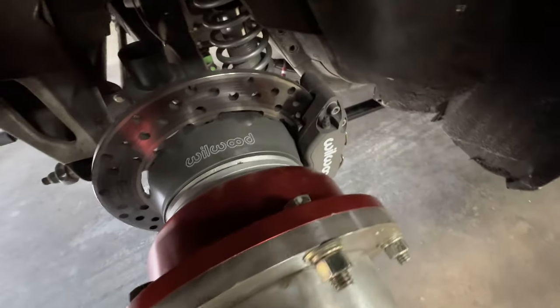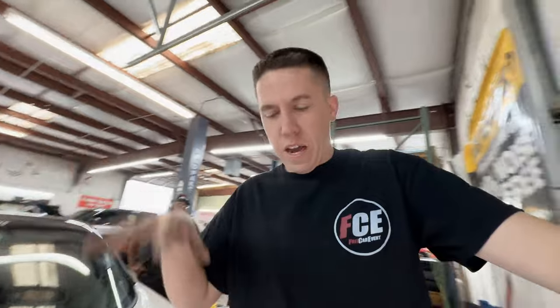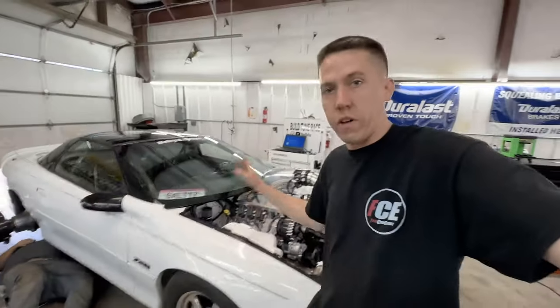This all started — I wanted to make the last pass, come dyno the car, try to make a thousand with the old combo, and then we hurt the motor. So Salty never even made it on the dyno with the old combo, which sucks. With the new combo, the oil drain lines don't have a huge downward angle, so you have to be careful with how much slant the car has.